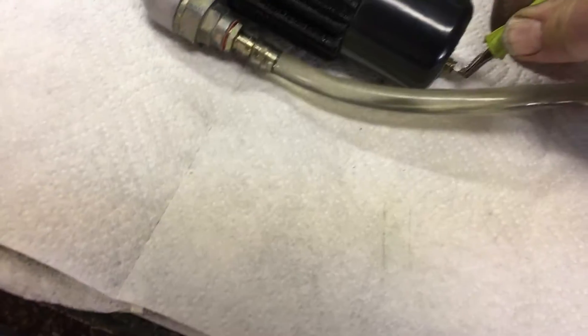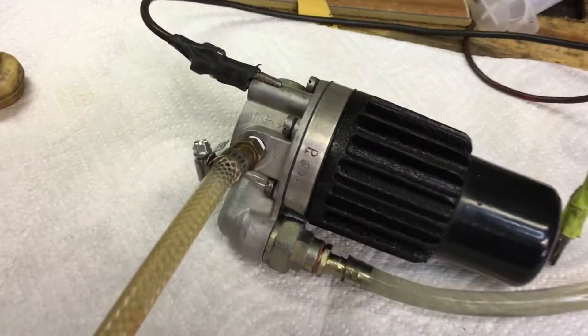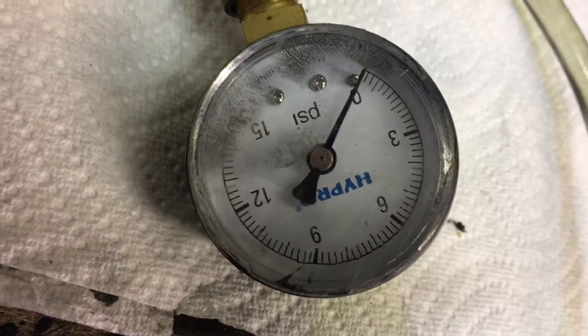I get a good grip on it. There we go. Okay, so you can hear it's ticking away. No leaks. Fluid is flowing back nicely into the unit. We've got it pumping up. You can see there's a surge there of about three pounds of pressure, which is typical for carburetion.